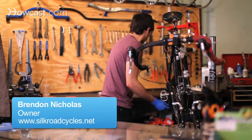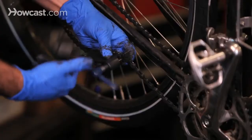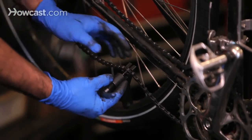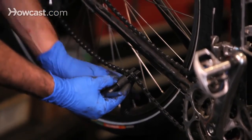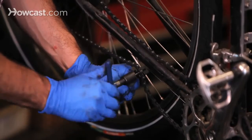While you get your chain tool, open it up so there's enough room for the pin to sit in there, and set it right down in there. Make sure that they're both together properly — you don't want to have one pulled to the side because then the pin will not go through straight. You're just going to push the pin through by tightening the chain tool.